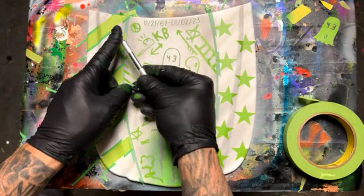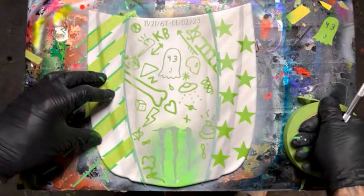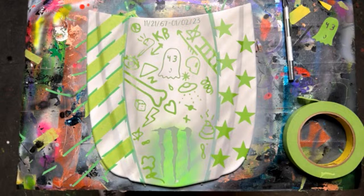But just keep in mind, dark colors to cover with pigment over the top could take more layers, and if you're doing graphics, it will take more layers, causing it to have more of a paint edge. But you can use any base ground color. I usually just use black or white. Silver, but really not even much silver. It's mostly just black or white. Well, silver for candies, white.